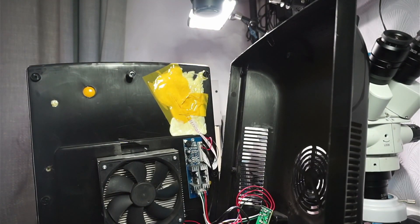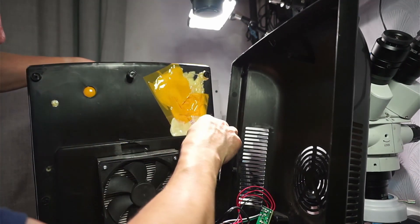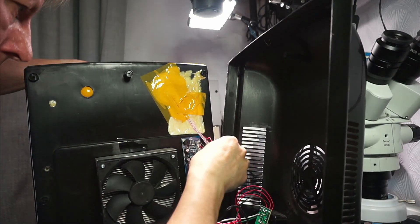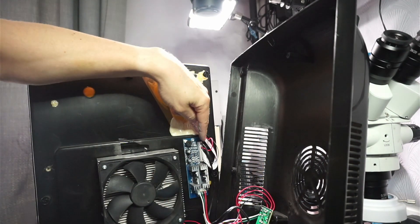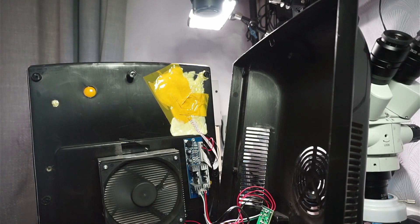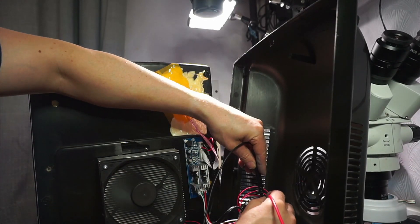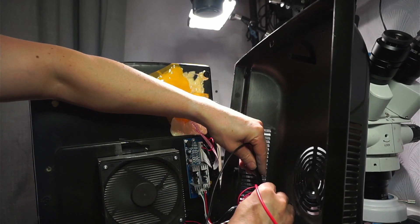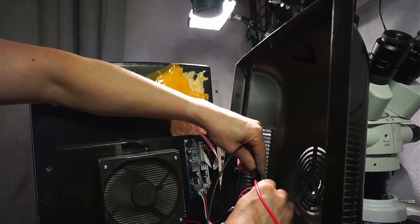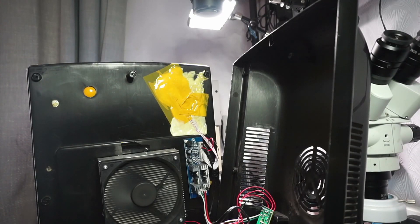Right, I'm switched on. I've got to be careful with this power supply, but I've got it set at 40. There are some connectors here which I've taken off — I'm just going to push them in, make sure they're all the way in, but they are just for the light and the stuff on the front panel. Now look — the fan's started up. I'm going to probe the power to the heating element, and I do get minus 12 volts. So that heating element is getting power. It's climbed up to 25, but that's only one degree, so I'm going to leave it for a few minutes and see what happens.